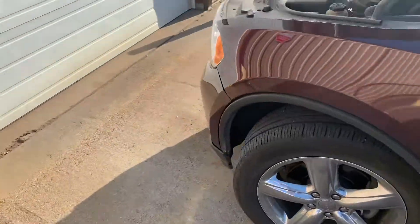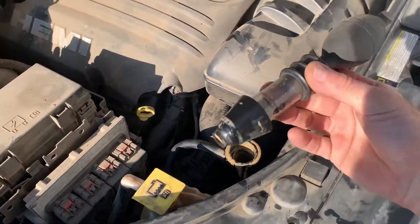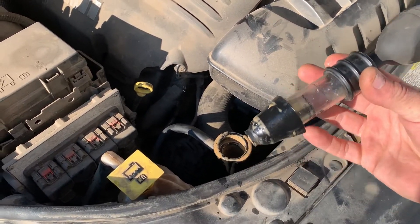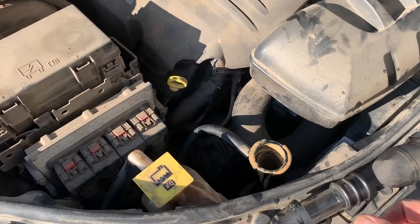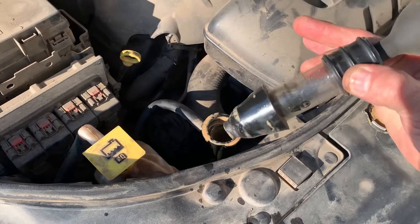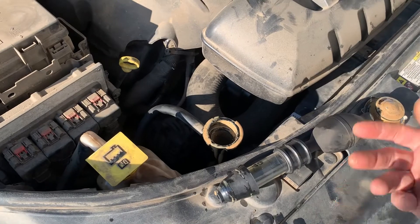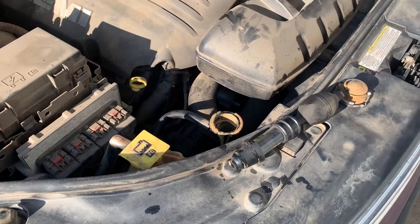Now we're starting to hear a slight engine tick as well. The purpose of this video is: one, to show you how we perform this exhaust gas check, because listeners ask what that actually means; and two, to show that just because there's oil in the radiator does not automatically mean the head gasket is blown — if this had passed and stayed blue, I'd be looking for other reasons for the oil mixing with coolant. In this case, it is a major repair.